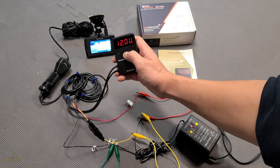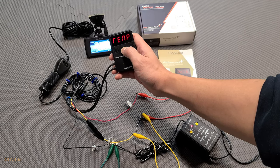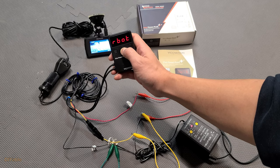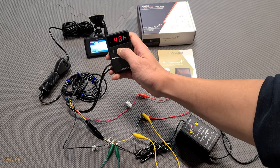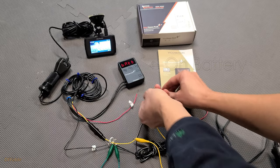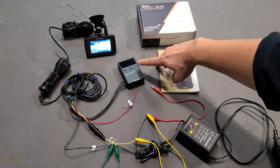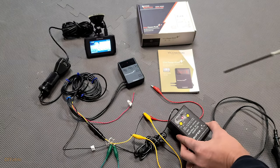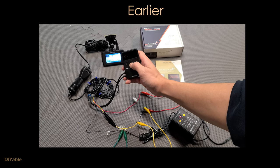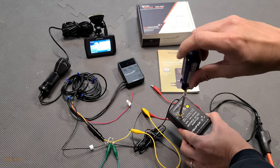I would avoid going lower than 12 volts. You can also set the temperature cutoff point to prevent overheating in summertime. There is also a duration setting — it would be amazing if your car battery could last 72 hours. When you cut the power, the yellow wire provides all the power to the dash cam. It will continue to run until the voltage drops to the cutoff point, which we set to 12.0 volt, at which point the power management system will cut it off.